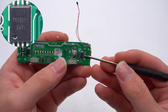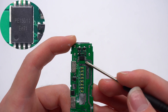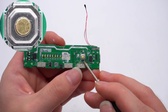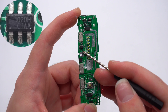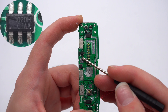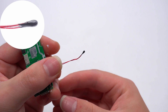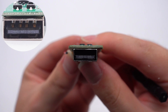The VBUS MOSFET used for USB-C is from ChipsourceTech, rated 18V 18mΩ. The VBUS MOSFET used for USB-A is the same. There is an SMD button for power detection. There are 8 LED indicators with TVS for electrostatic protection. The battery protection chip is from Medchip and integrates voltage and current detection circuits. The MOSFET for battery protection is marked with 2002. The thermistor is used for temperature detection. Here are the black USB-C and USB-A sockets.